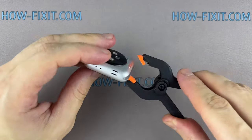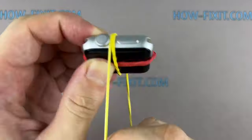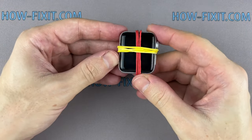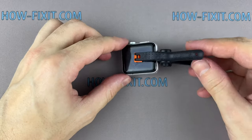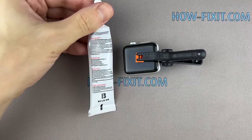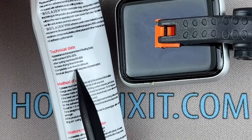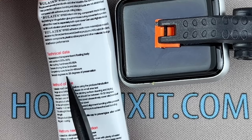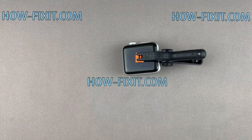To fix the display and the main housing, you can use clips or rubber bands. The B7000 glue dries completely after 24 hours, but the minimum surface drying time is 6 minutes. I recommend waiting at least 45 minutes, after which you can remove excess glue.